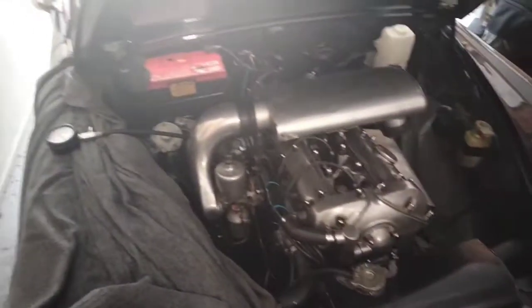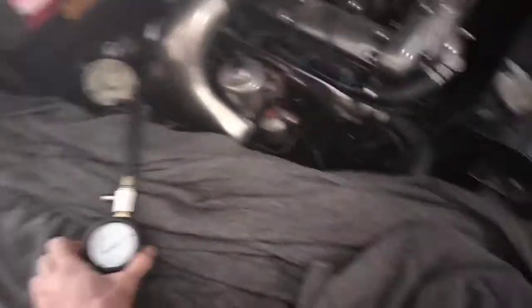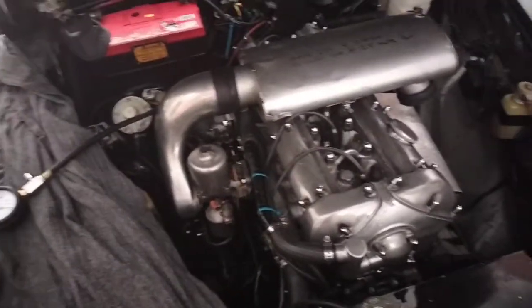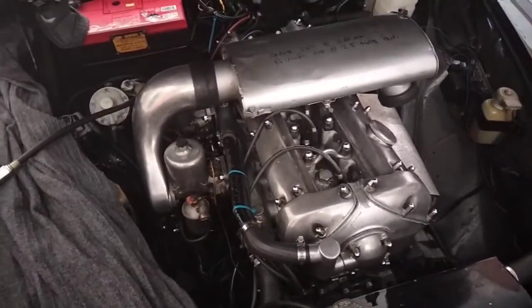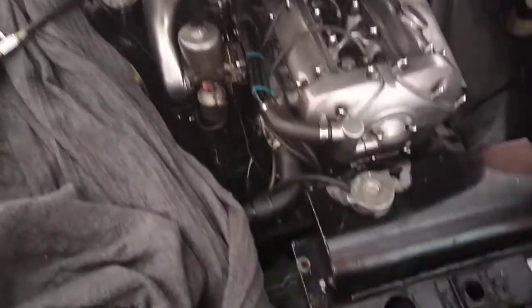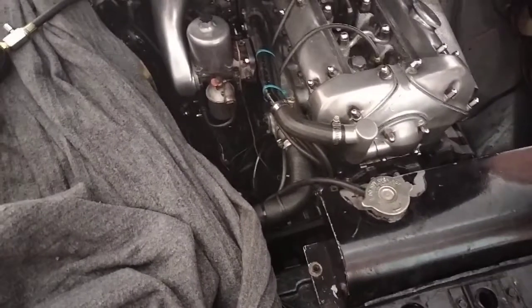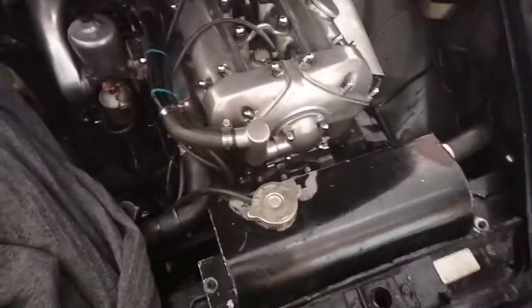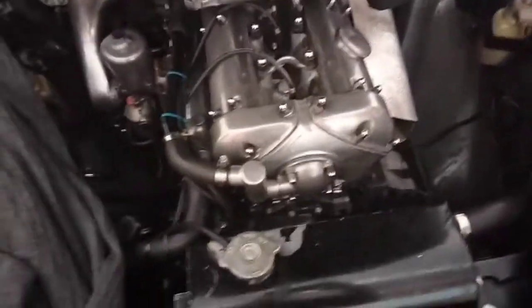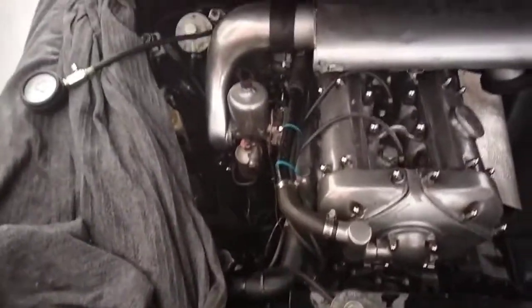Alright, I just dragged out the vacuum and that's sorted out. It's now the next day — I finished up about eleven o'clock last night. Put everything back together. I haven't started it yet, so I put the mechanical gauge back on. Pretty confident everything's where it should be. The only thing is I adjusted the idle last time I had it running, so it may not jump straight up. My biggest concern is the power steering pump — it's probably going to leak all over the floor. It's running low on PS fluid so I'll have to go and pick some of that up.